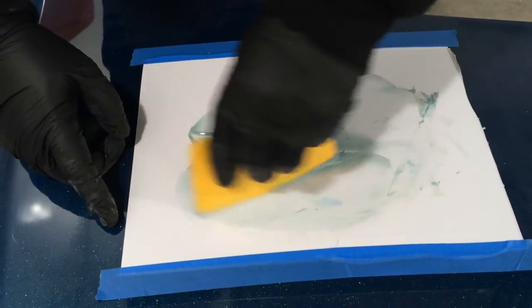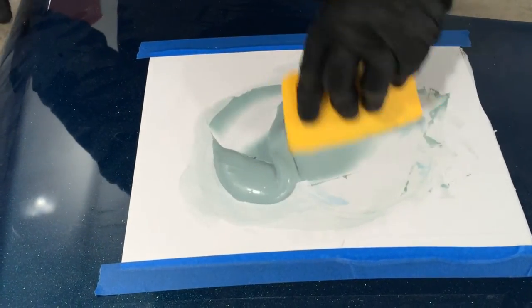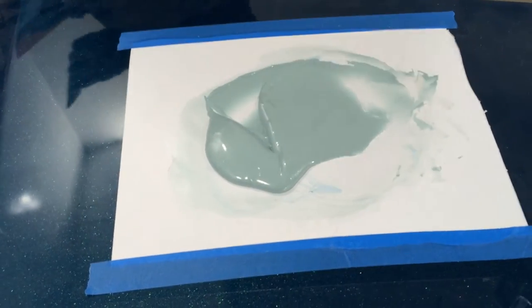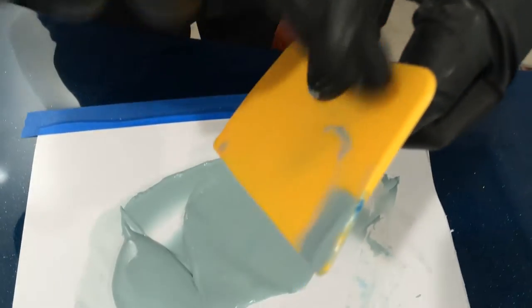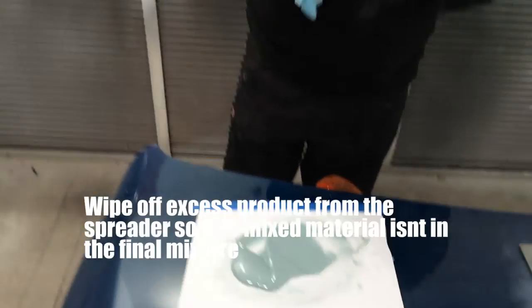Once I've done a bumper and smoothed it off, I have no qualms with chucking it off the top of my booth. If it doesn't crack, brilliant - job done. If it cracks, sand it down and redo it. That is actually how I test my bumpers. Also, you can see there just before I clean that off - we've got some trace hardened product, and some product that's not had hardener mixed in at all. These are those little tips.